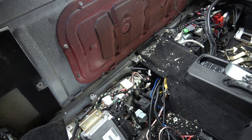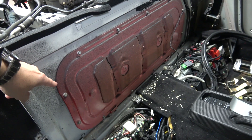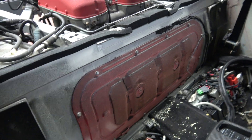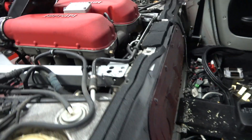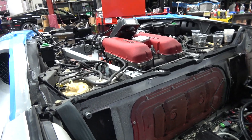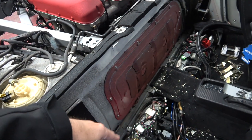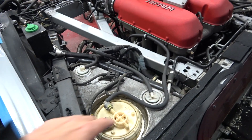You can see all the computers and electronics down here under the seat. Normally I would put a set of golf clubs or something back here. This is an access window — it's on both the coupe and the convertible — and that access window allows you to do the timing belts on this side of the engine without taking the entire engine out. But when you take the car apart to this point, removing the engine is not a big deal. If you ever have windows open and get water in the car, it's not uncommon for these floor computers to get water and go bad.